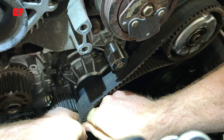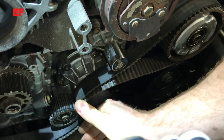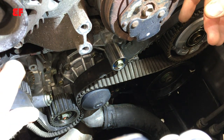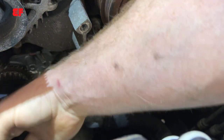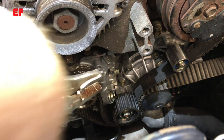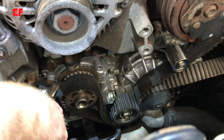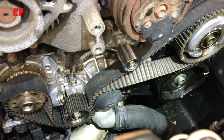To hold the sprocket, get an old belt and weave it in between two pulleys — have it as taut as you can, though we'll final tighten at the end so it doesn't have to be crazy tight. Terminate it at a third cogged pulley, which I always end up doing at the crank pulley. Once it's at the crank pulley, you need two pairs of vice grips to pinch the belt together, mesh the teeth, and tighten it as tight as you can. Note that the vice grips can damage the belt, so always use an old belt.